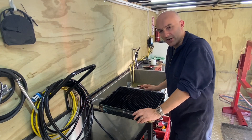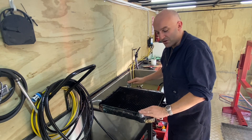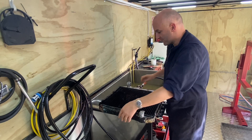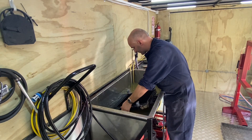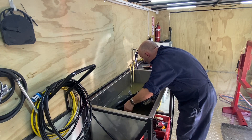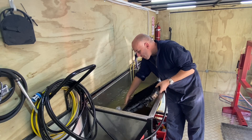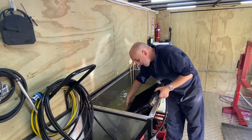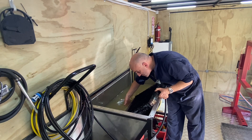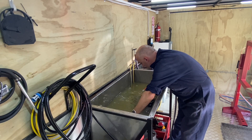So here we go, we've got that radiator ready to go. You'll have to excuse the improvised testing plugs. I'm still waiting on my testing plugs to turn up, so I've just got some rubber plugs in there duct taped in, but it'll do for this job. Put some pressure in there, then we stick it in and we check for any leaks around the tubes or cracks in the tanks. Looks like there's no leaks around the tubes, which is good, and no cracked tanks, which is also good.